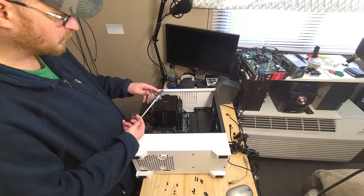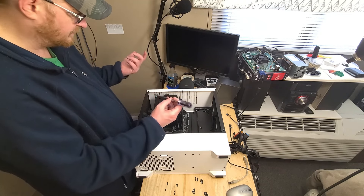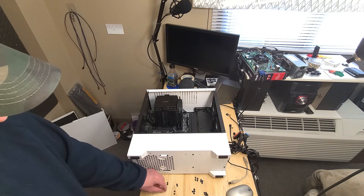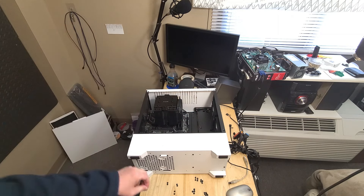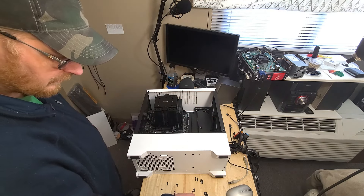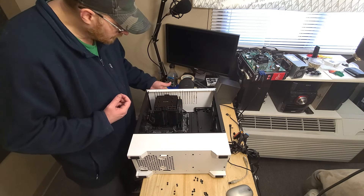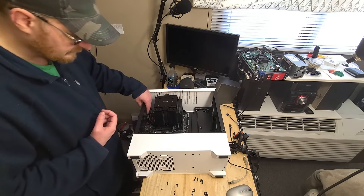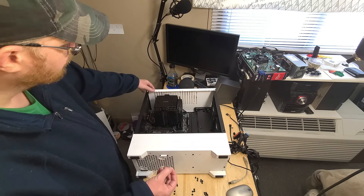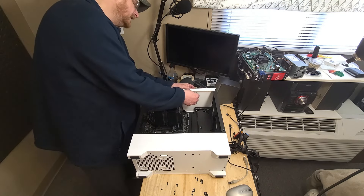This is a good screwdriver - the length is why I like it. It came with this cooler because you take this little screw off, the fan is removed, and that's how you screw it in, so you need these longer ones. The case comes with a bunch of smaller screws, then you get four for the power supply and eight extra screws for fans. If you're putting two fans on the front and top, you'd be a little short on screws. They give you these flat-head ones, and the top is even rounded, so they give you these for a better look.